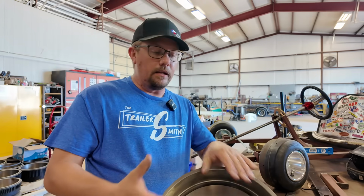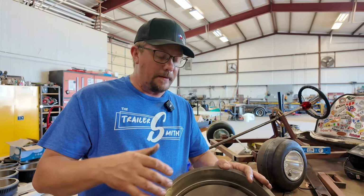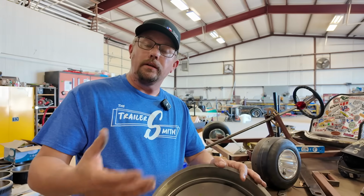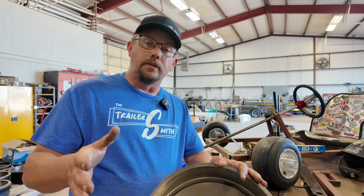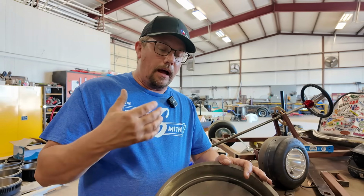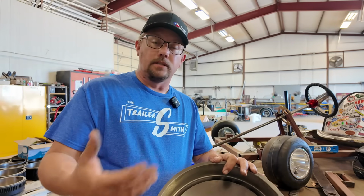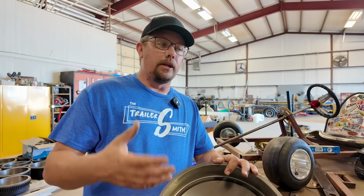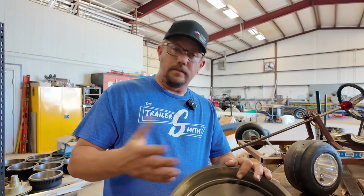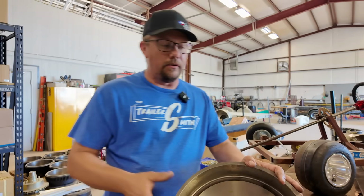It's basically just, in the beginning, getting the brakes warm, getting them hot maybe, not to where they're going to burn all the grease out of them, but speeding that process up, getting them burnished in, and either manually doing your first adjustment, which I recommend whether you're using an auto adjuster or not, or hoping that your auto adjusters will do that initial brake adjustment. After that, you need to be adjusting your brakes per manufacturer spec. Every spec is a little bit different, but if they say to do a brake adjustment at 3,000 miles, you need to do it at 3,000 miles. If they say to do one at 10,000, then do it at 10,000, depending on size of axle and, again, on the brake system and manufacturer.